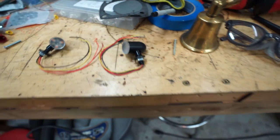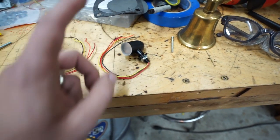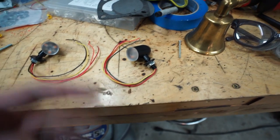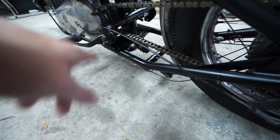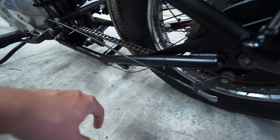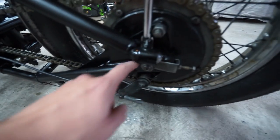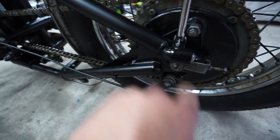On this bike I'm running what the M-unit calls a one-wire tail light, meaning I can connect the tail and brake light wires together and just run one wire, and the M-unit will automatically modulate between tail light and brake light. So when we originally wired up the bike, I have a ground run back here, both turn signal wires, and then the one wire from the M-unit for the tail light itself. I'm going to cut all the zip ties out, get all that wiring out, mount the lights up, and then map out the connections and make sure they're heat-shrinked and as clean as possible.